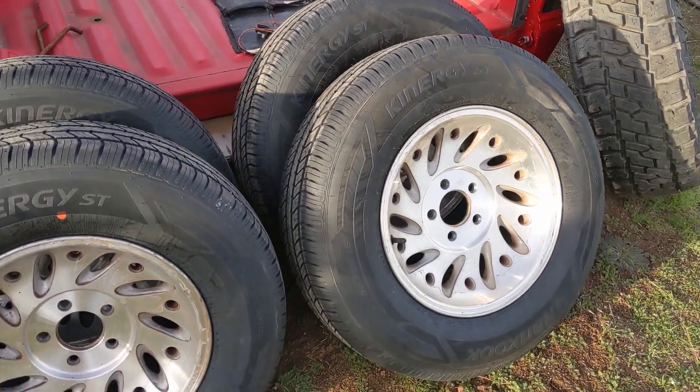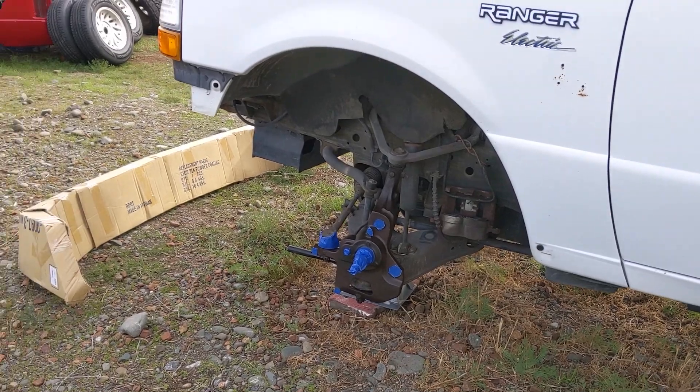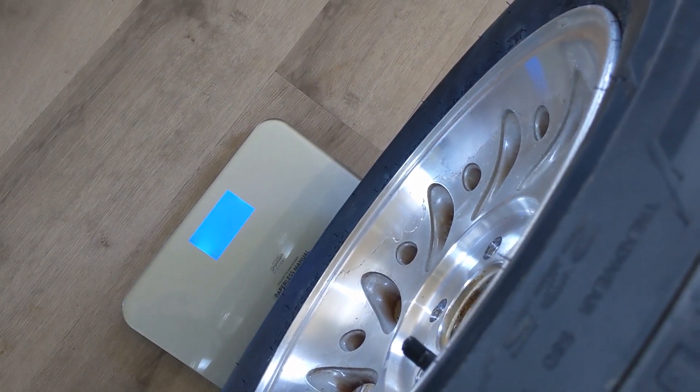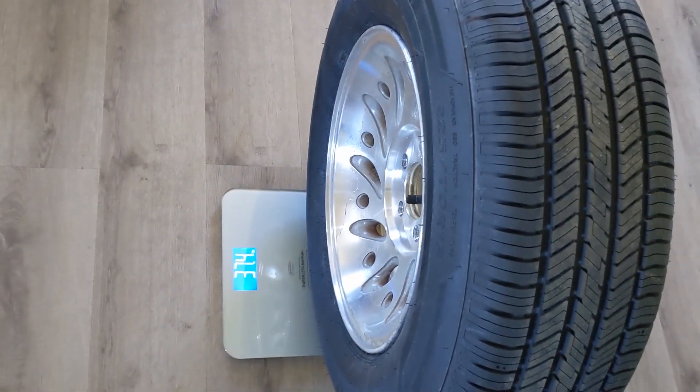For you it's just been a few moments, but for me it's actually been a few days — I've had a lot going on. I wanted to close out with the tire update: the tires are on the rims, balanced, mounted, and holding air just fine. I haven't put them on the truck yet because I'm still in the process of replacing the brakes. I did have a chance to do a quick weigh test — total weight for these with the 15-inch cast aluminum rims and Hankook tires is 38 pounds.